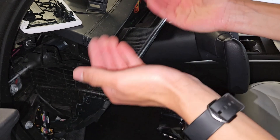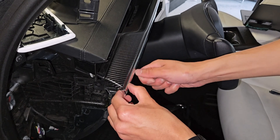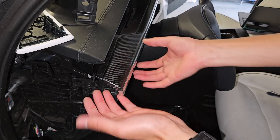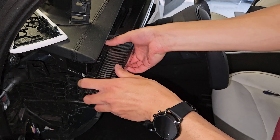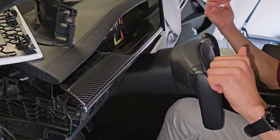Once you have these bolts removed, all you need to do is come up from underneath here and start kind of rocking it up from where it sits — it's just being held in by clips. Both the plastic chrome trim as well as the carbon fiber, or whatever dash you have, you're just going to rock it up away from the car. This part is loose; you can go do the same thing on the passenger side.